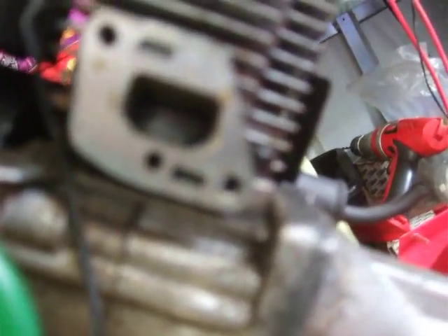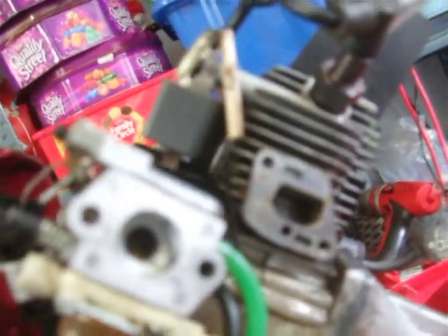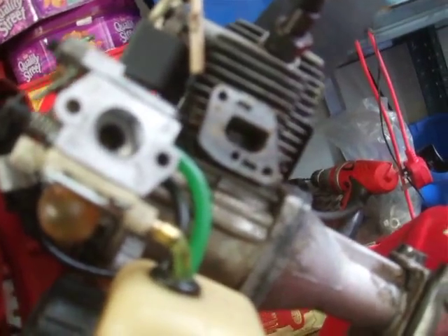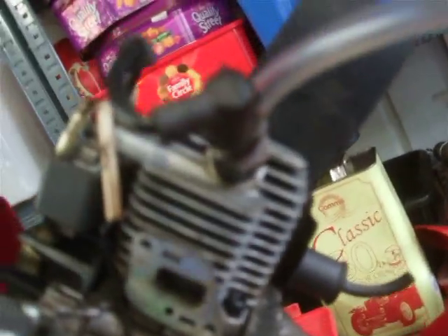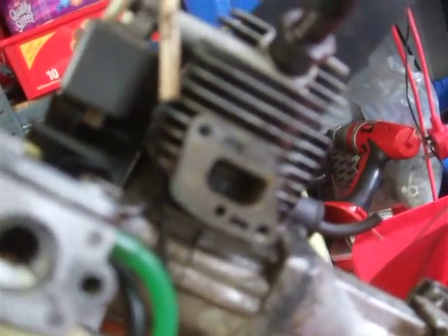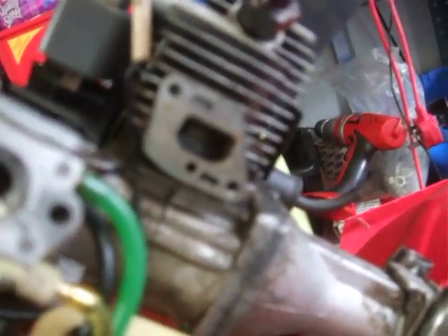It's got like a grey washy colour. I'm wondering if that's seized before — the rings were stuck in it before — and I bet it popped out under the pressure. It's not a bad little job on these because the cylinder's just bolted here. You just unbolt the cylinder and pop it off, and put a new piston on the cylinder if it comes to it.